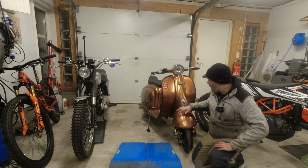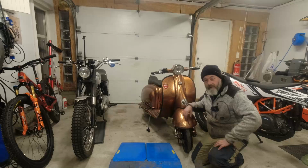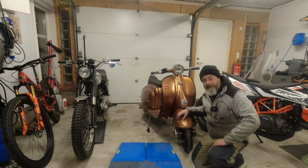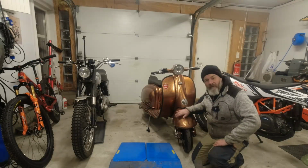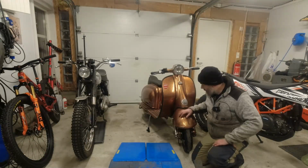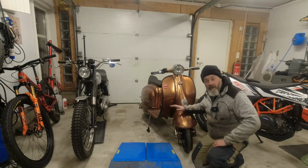One little niggle I had was the fact that the handlebar isn't lined up with the front wheel, so it felt like it was riding a bit skew. And that's a bit odd, isn't it? You would have thought with the Spanish front mud guard that'd be the easy job. Never mind. So I'll adjust that, and we'll call it a day.